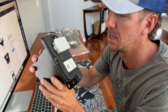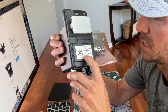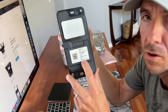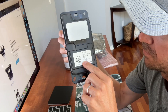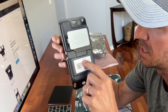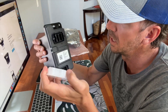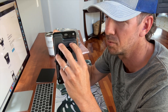So this is the battery — if you haven't seen it yet, I've done a couple other videos on it. Basically, it's a nominal voltage battery at 41.6 volts. They call it a low voltage battery on the unit itself, but on Tesla's parts diagram they call it a medium voltage battery. It's got 4 amp hours, energy of 166.4 watt hours, and the part number is 1679931-00-F. It has a positive lead, a negative lead, and a Tesla plug on top with a rocker and slide locks on each side.